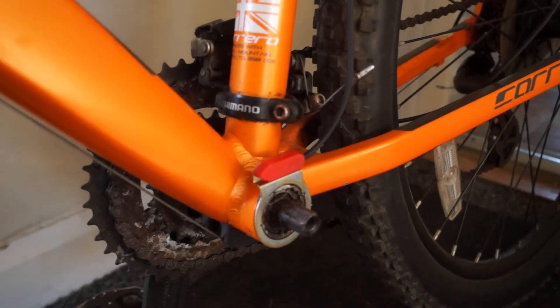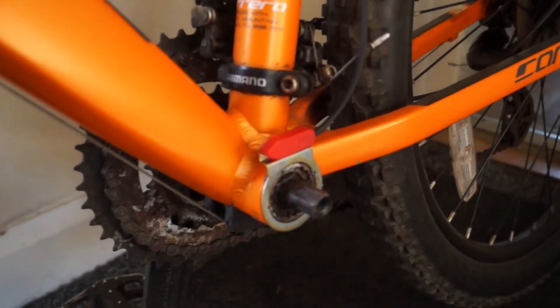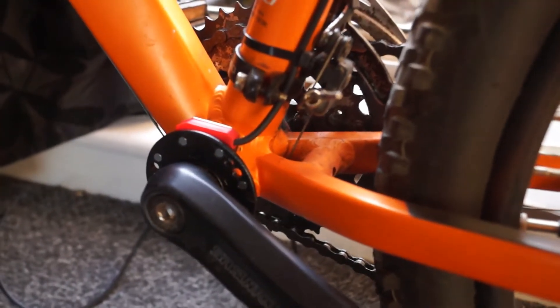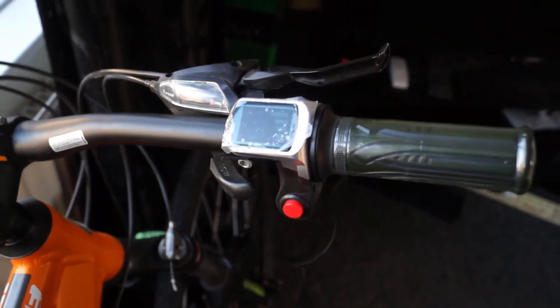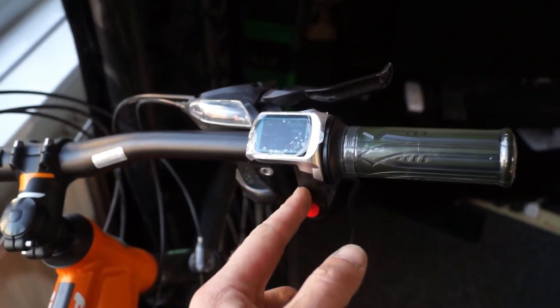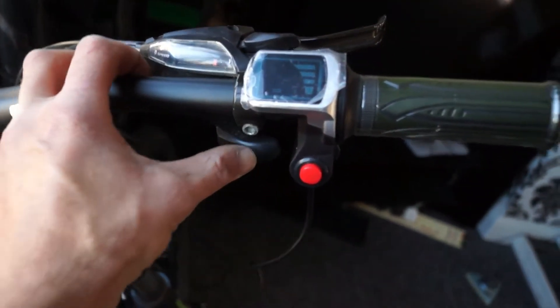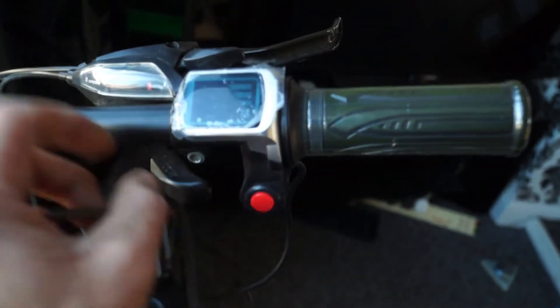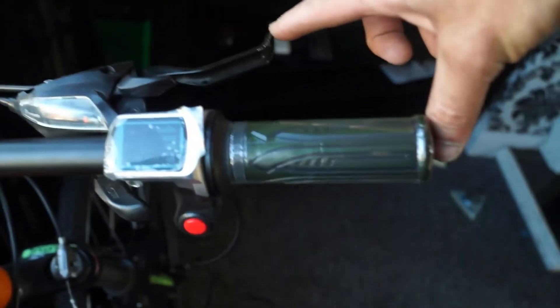The instructions are diabolical — it's completely different to the one in the book. No bolt holes, no brackets, it's just a ring. Anyway, I've glued it on and I'm going to have to work out how to fasten it on permanently. My next challenge is to fit the grips that came with it. In order to get the old ones off they're that tight I'm going to have to cut them off. Another problem: this bike has got gear shifts here and there, so in order for the twist grip to clear the button, you've got to set it right back — which means your brake lever ends up in an awkward position.